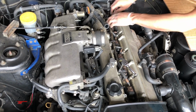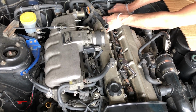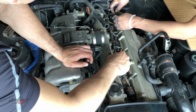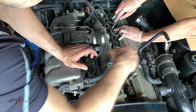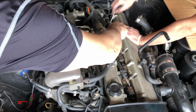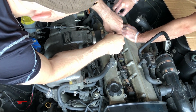Okay, so that number 6 came out pretty smoothly. I don't think it broke. I think that was a good non-breaking noise. Well, it looks like even if it broke, it didn't break much, and it'll still work pretty well. For sure. So the key is to gently press this release tab down. Sometimes when you press down the release tab, it just breaks, and it's just inevitable, and that happens. But try to make sure there's as little pressure as possible coming down on the release tab.